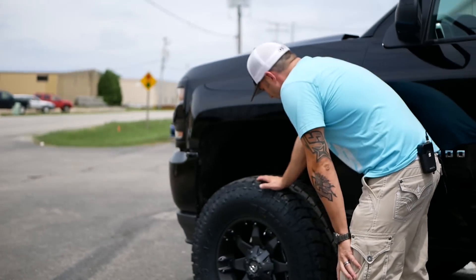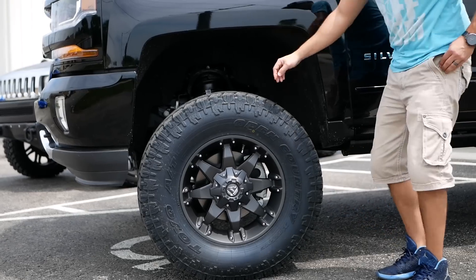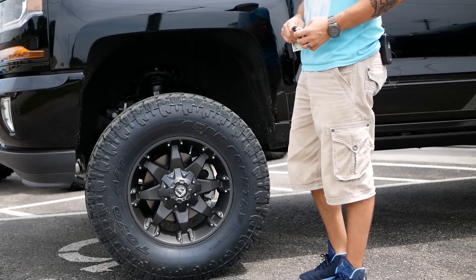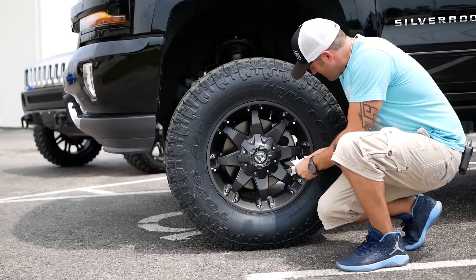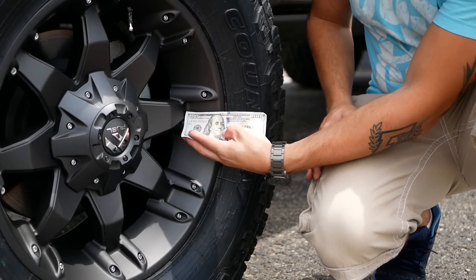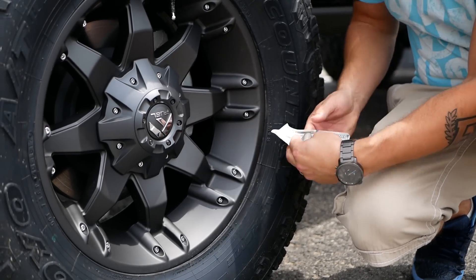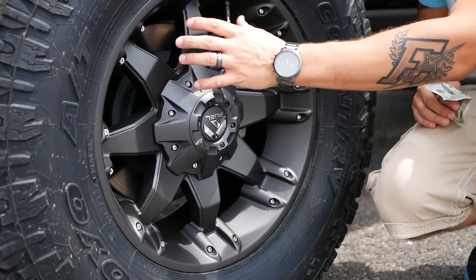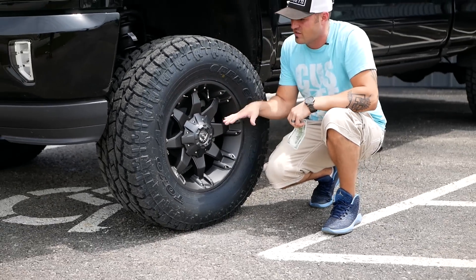For fitment, he went with an 18x9 — so it's an 18x9 wide, negative 12 Fuel Octane. And since you guys spoke up, brought back my Hundo Mario. This is a weird one to do a lip test, because you could kind of do it like this and say it's about two, two and a half inches. Or you could lay it here between the spoke up to this ridge and call it a 3-inch. But pretty much anyone going with a 9 wide isn't really looking for a lip wheel — they're looking for the design and style of that wheel.